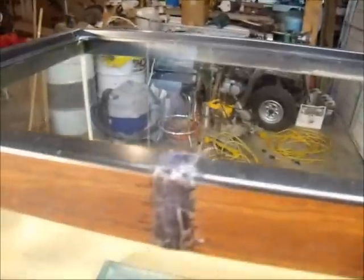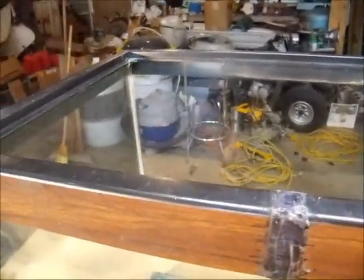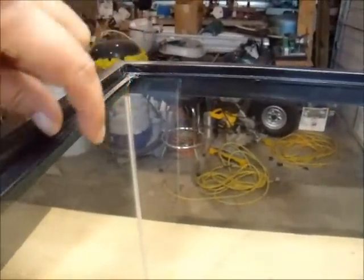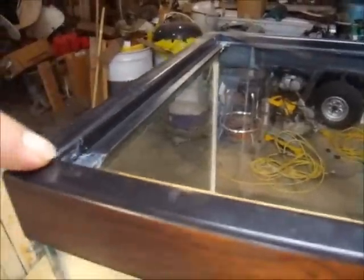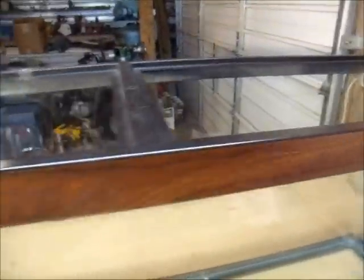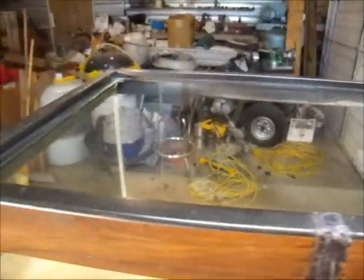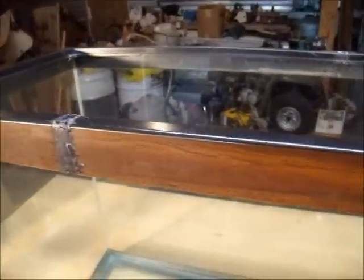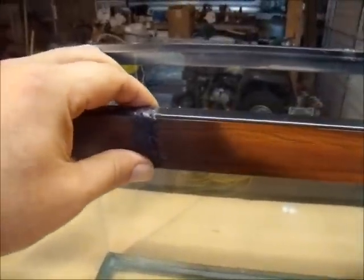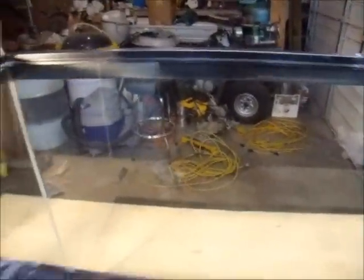If this looks like there's going to be a structural issue — which I don't think there is — I'll cut some strips of plexiglass, full length about an inch wide, and epoxy them in here, over here, and here, just inch strips. And what that would do is make this really strong. But I don't think it's a structural issue. I think it was just because when I handled it, it was really cold and it broke here, and these cracks were kind of at these four corners.